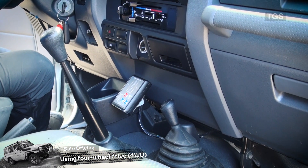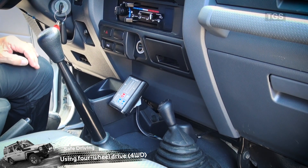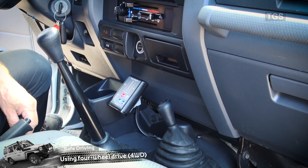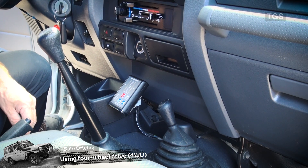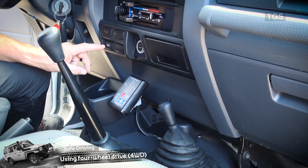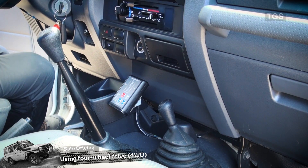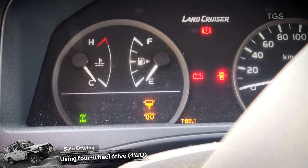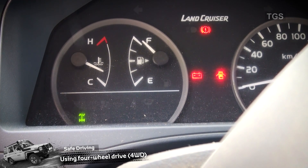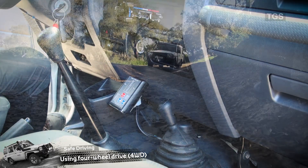When it comes to engaging four-wheel drive, we need to know and understand the lever and switch mechanism. This vehicle is in two-wheel drive most of the time. When the road becomes bad, we go to four-wheel drive high — we press the H4 button, and when the ignition is on a green light will come up on the dashboard. This is for normal roads with dusty tracks and some difficult terrain.